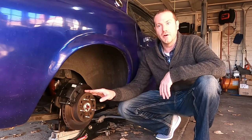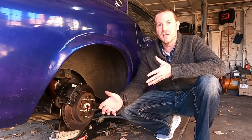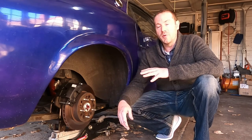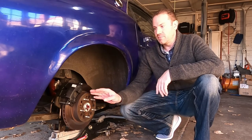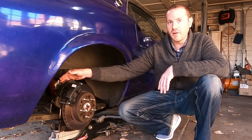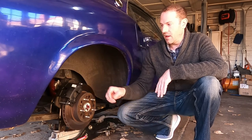In this video, we're going to talk about this Quick Performance four-wheel disc brake conversion. I ordered this Quick Performance kit, including the rear end, the axle housing, and the brake kit all as one. But you can buy the brake kit on its own online from Quick Performance in Iowa. This particular kit sells for around $375. It contains the calipers with the parking brake assembly, the rotors, the brackets — which are bolt-on in this particular case — and the backing plate.